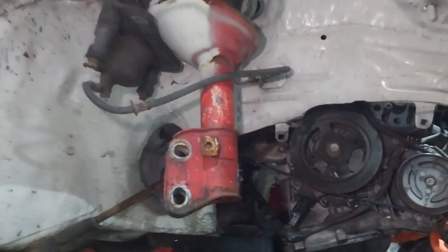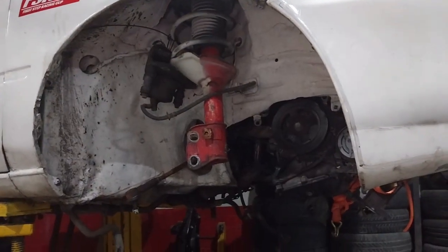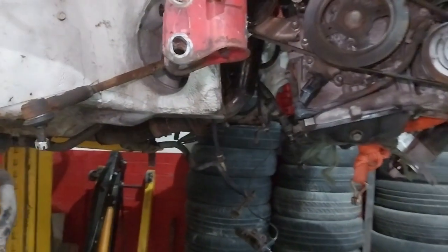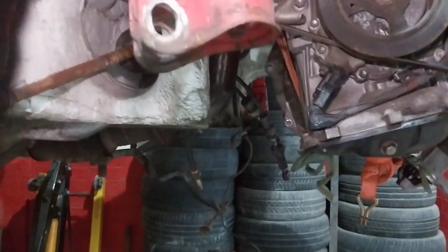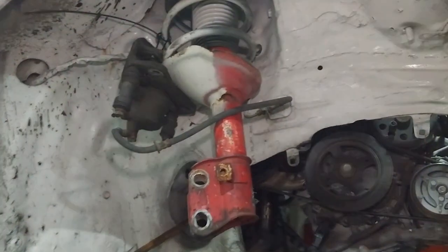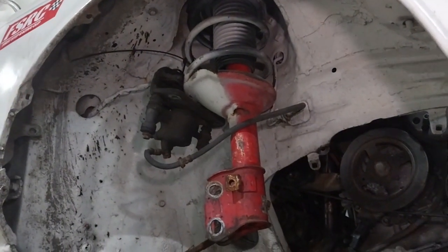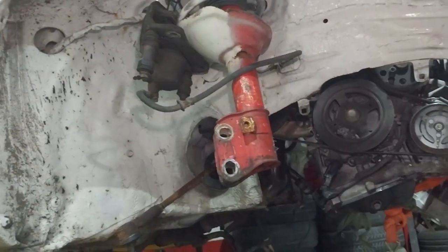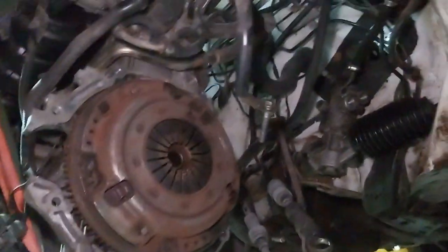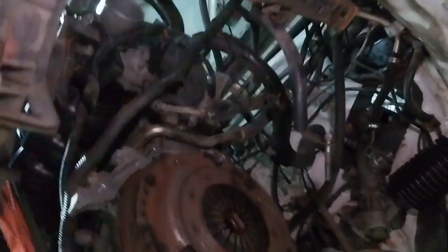Let me show you around the car. There are no wheels — the lower part of the suspension, the wheels, the knuckles, and the axles are all down. The whole transmission is missing too; you're not supposed to see all the way through to the other side. We have inverted strut shocks from a Subaru STI GC8, which still seem to be in good condition. The starter is hanging, the clutch is visible, and there's an open chasm in the engine bay.